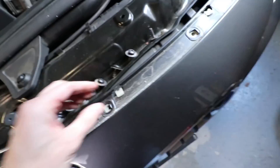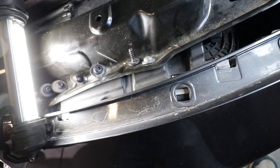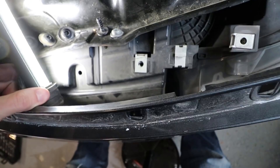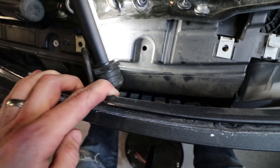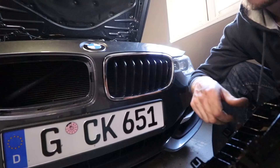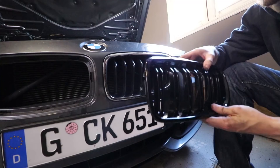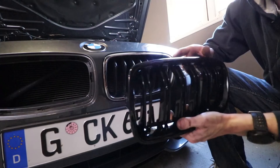Now that we've got this grill pulled away, I'm going to show you down in here. You see that tab? Dead center of the screen, and there's one right under my finger right here — those are what you need to push down. After some trial and error on that side, I'm going to show you the easiest way to do this. Once you have all that top stuff removed, you're going to need that in order to access this easily. There are people that claim you can just come in here and pull, but maybe if you have 20,000 joints on your hand — not for me.